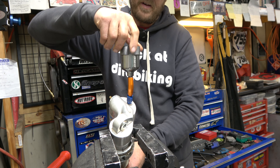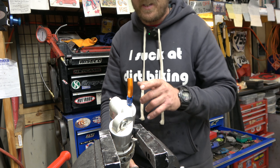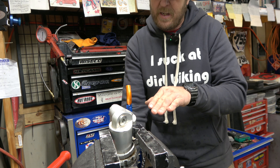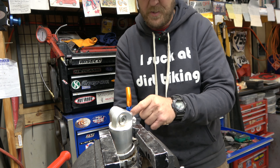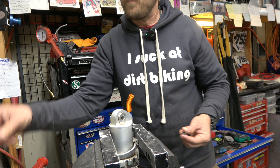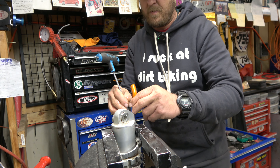Now I'm going to empty the bleed cup. When we take this off it exposes the shock to air before the screw goes back in — but when you pull this off it's going to be over-full, basically coming out. This is also where you have to unscrew the vacuum bleeder, so even with a vacuum bleeder you're still unscrewing this and leaving it open to air momentarily. I'm going to keep it straight up and down and be ready with the bolt.